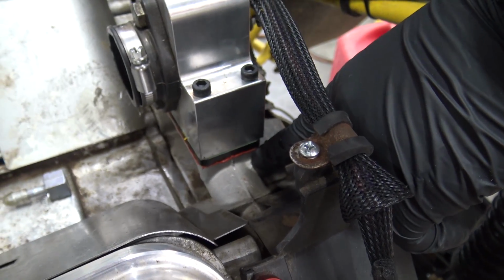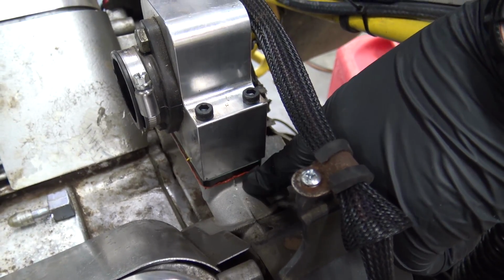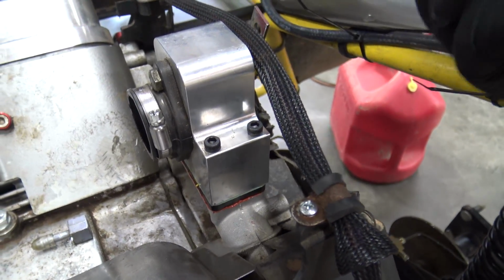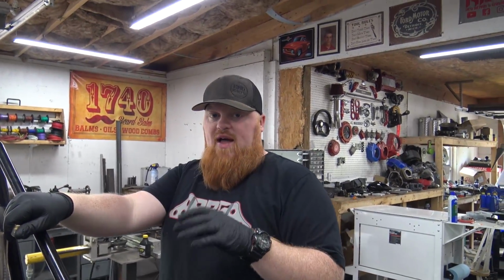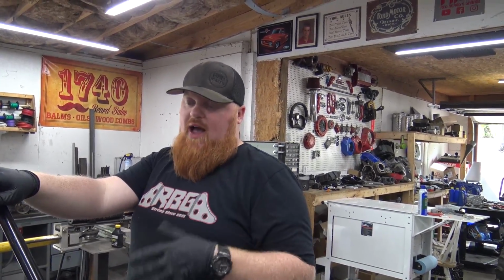You can see I had to put RTV because the guy also left the bottom gasket out. As soon as I sprayed brake cleaner around this, it would rev up like crazy. So it had a really bad vacuum leak. Once I fixed that, the thing idles perfect now.